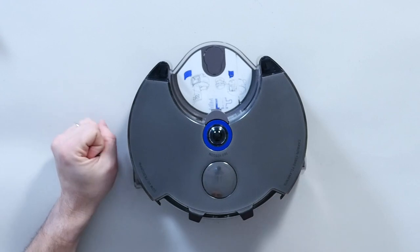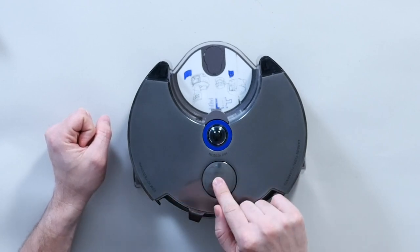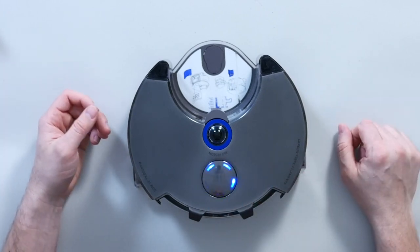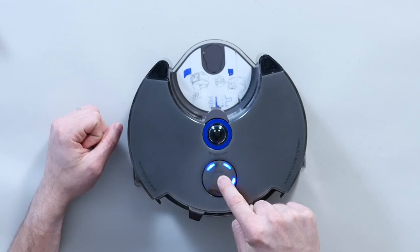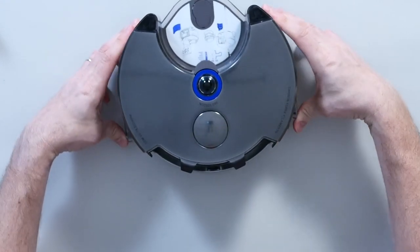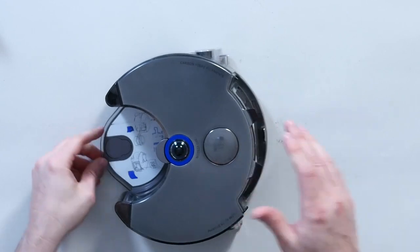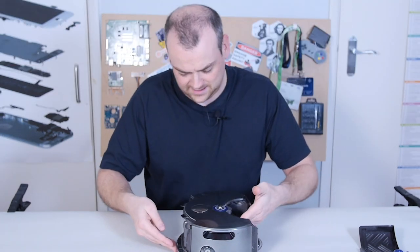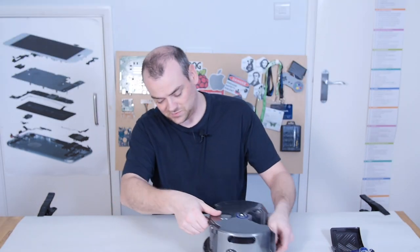Before we really take it apart, this button on top is actually the only physical interface it has. There's a little charging light and you press that to pause it. You can see that the clear plastic base is actually not completely attached to the opaque plastic body when you've got the dustbin on the front — that's probably the first to knock anything. And I can very slightly hear a microswitch, so that's probably its first bit of collision detection.